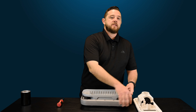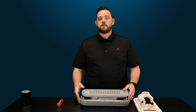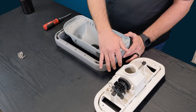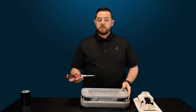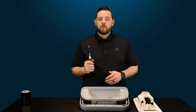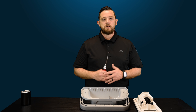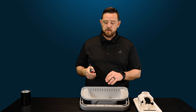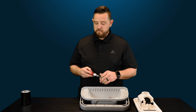This bumper is going to take all of the hits and abuse as it flies around and buzzes around the bottom of your pool, gets kicked, whatever it may be. It's important to make sure you have this in working condition. To remove it, it's really simple — locate these two screws after you've removed the top shroud. You're going to use a Phillips head screwdriver. This cleaner has pretty minimal maintenance and you really only need one tool to do a lot of repairs. Always keep a Phillips head or flat head screwdriver around to get these out.